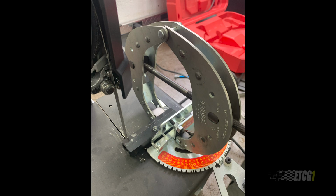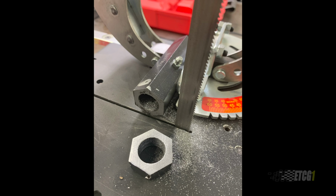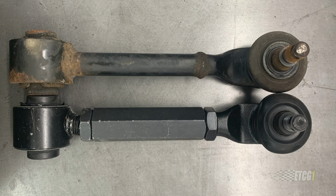And by the way, this happens to these Odysseys because the springs, as they get old, will sag a bit, and as a result the rear wheels will start to camber in. So this is an issue you might deal with. I'm sorry I didn't make a video on the replacement of all that stuff. But what I ended up doing was cutting about a half inch out of each one of those turnbuckles, and that's what I'm left with here. I'll throw some pictures up on the screen of how I accomplished that, and that seemed to do the trick.